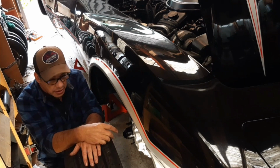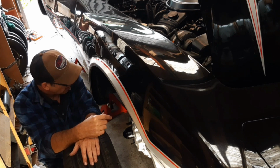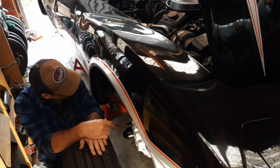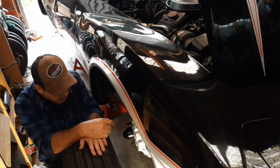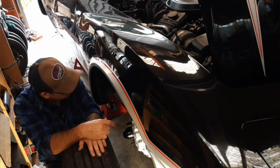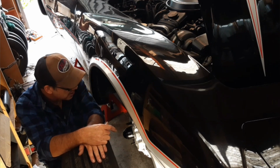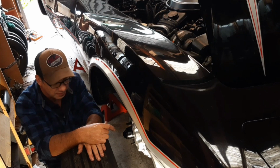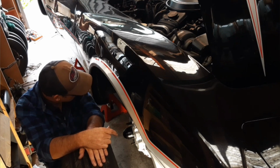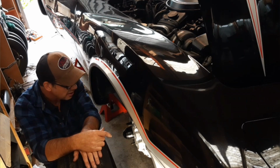Then it just leaves ball joints front and back. Ball joints left and right. Upper and lower bushings to the upper and lower arms. And then on the back, just those, I think they're tie rod bushes to do. And at that stage I'm getting pretty close to being done with all the joints and bushings that I need to do around this car at this stage, until I'm told otherwise. But I believe at that stage I will have gotten probably 90% of all the bushes done, and hopefully that will see me go through my inspection clearly.